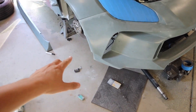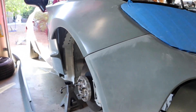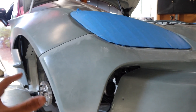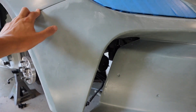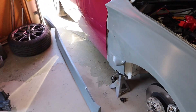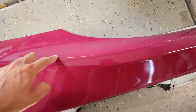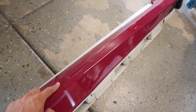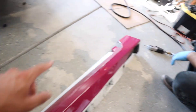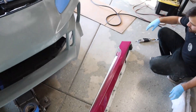The bumper is all good, attached to the fender. We're actually going to do some body work later to finalize everything — that's the thing with fiberglass kits, it's not gonna be perfect, so we'll probably do a little bondo until the fitment is on point. Moving on to the side skirts now, working our way back. The Street Hunter side skirt mounts on top of the OEM skirt, so we have to cut along this line to clear space for the Street Hunter skirt to attach in front and back. We're gonna chop it up and show you what it looks like.